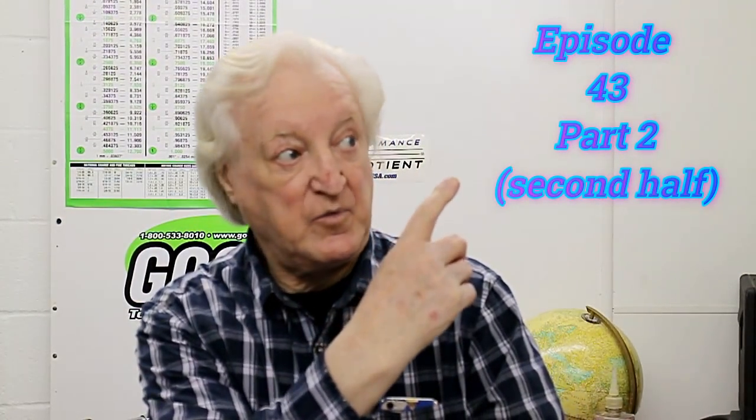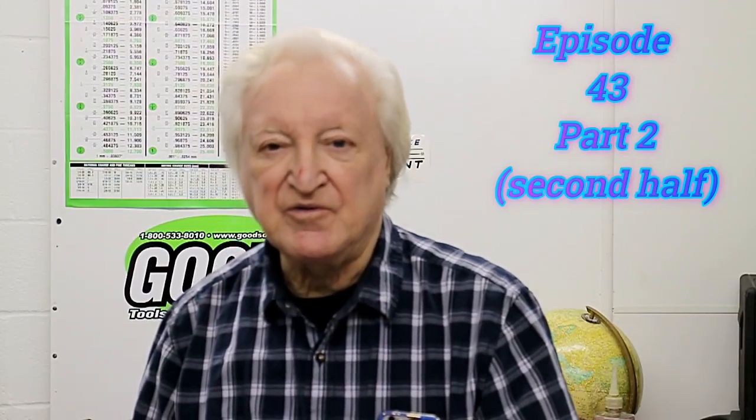In this episode, we are going to deal with the flow testing of Richard Holtner's turbo Chrysler head. What we will be showing in this episode will be the principles that we are going to use and the flow testing of the intake port. We will do the chamber and exhaust port in their own separate issues because there is enough to show in each one to fill a video.